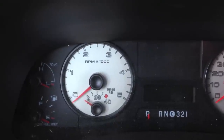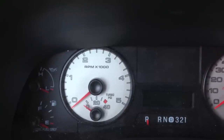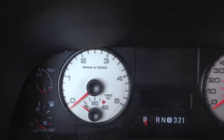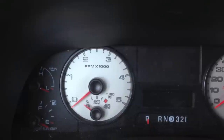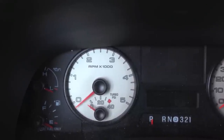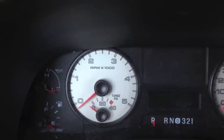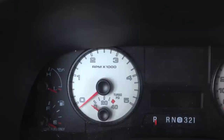When you have a crank no-start and your ICP pressure is really low, like less than 100, I say 100 because sometimes if you have an 04 style sensor, an 03, it can read 60, 70 PSI key on, engine off. And we also just want to make sure you have adequate oil.